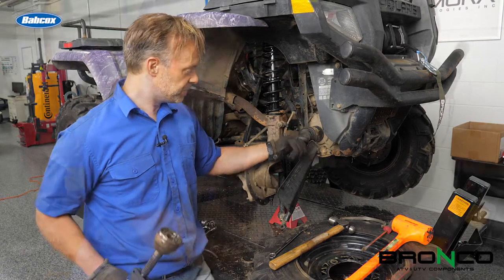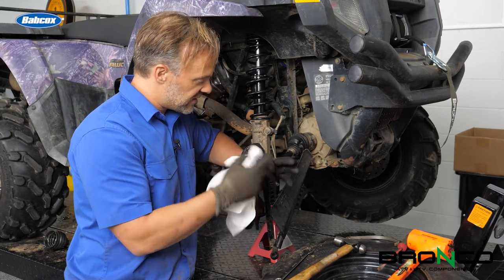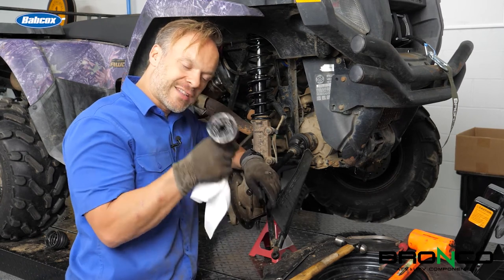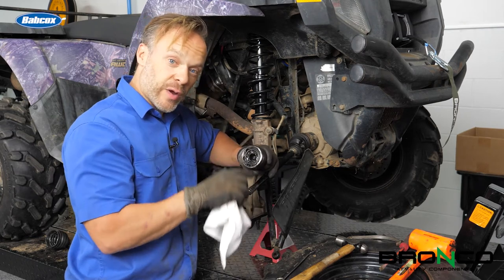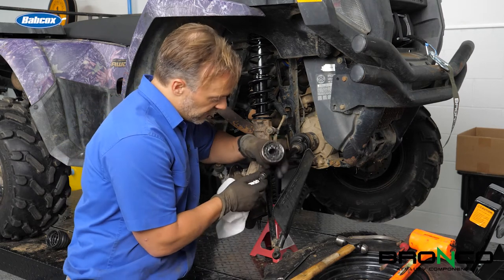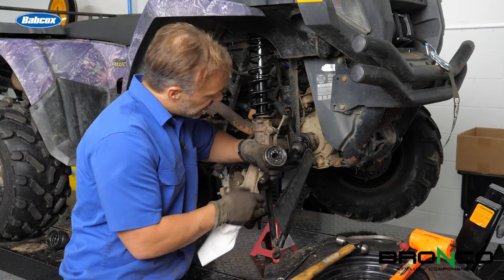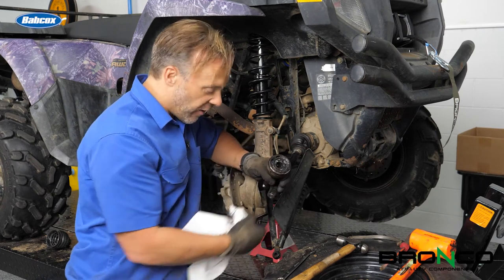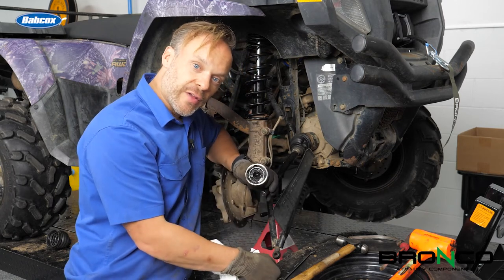There we go. When you look in here, this grease actually still looks pretty good — not seeing any big chunks of dirt, no metal flake. The grease is pretty good, but it still wouldn't be a bad idea to clean some of this up so that when we pack the new one, we're packing in a bunch of good fresh grease. You can see the spring clip that we had to get around. We're also going to do the top boot here because it's super simple — we've already got everything apart, we just need to undo those two spring clips and then start putting the new boot on.